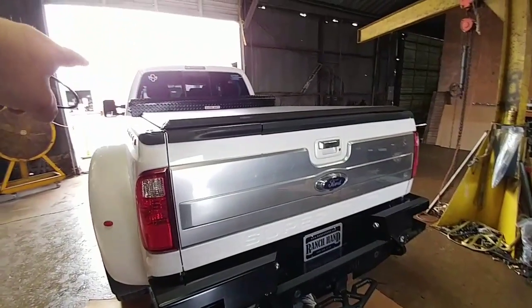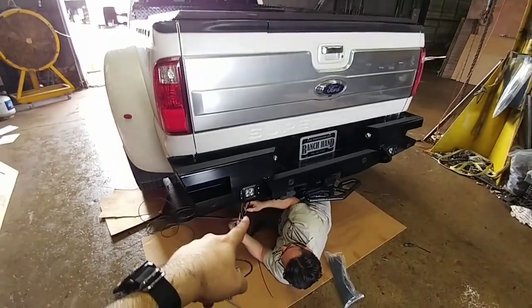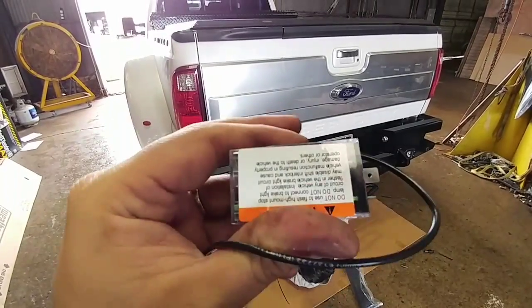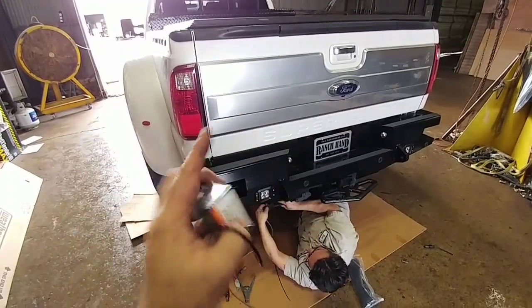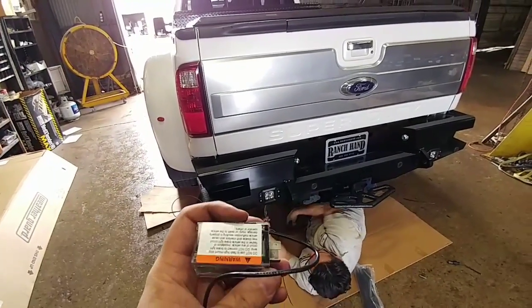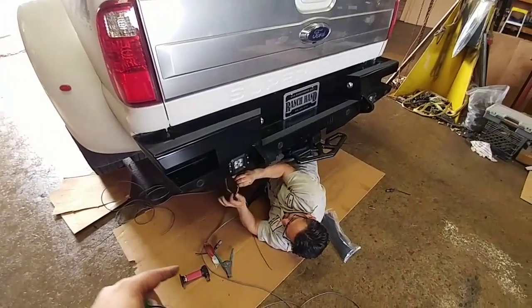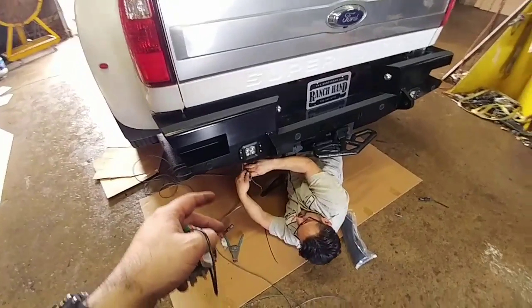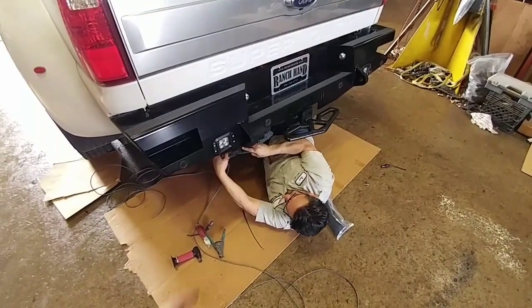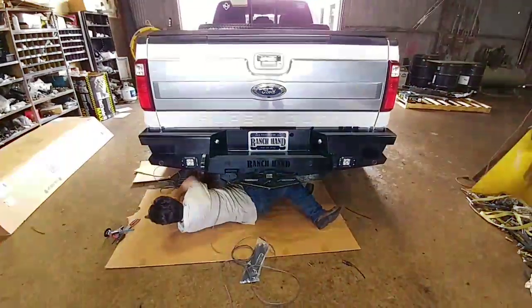Since I don't really want to drill through the top of this toolbox to mount the strobe lights, we're actually going to wire the lights that come with the Ranch Hand bumper to a Federal Signal wigwag. This is basically a strobe or flasher that will have them alternate, so whenever I need emergency roadside lighting I can flip these on and they'll strobe back and forth. Right now they're actually wiring these up — most places would probably just put a twist clip or a cheap connector, but he's actually crimping and soldering all the connectors, then heat-shrinking them.